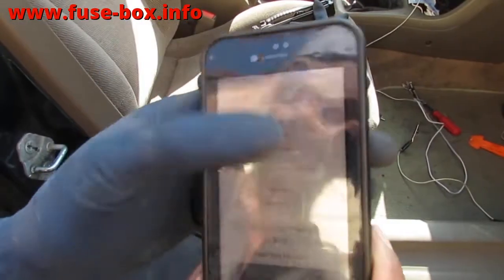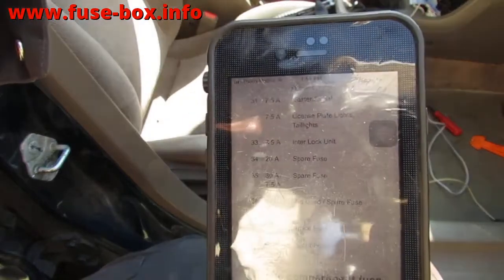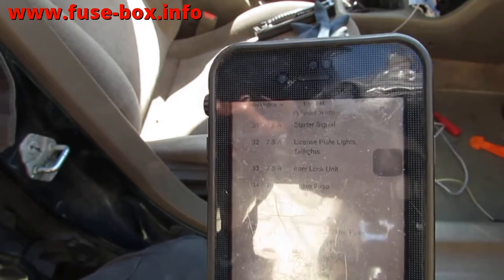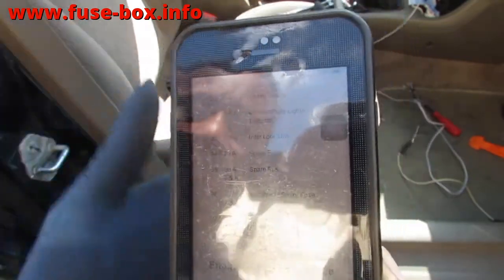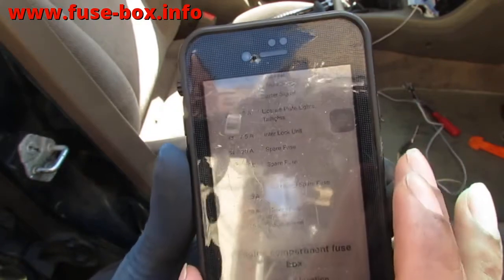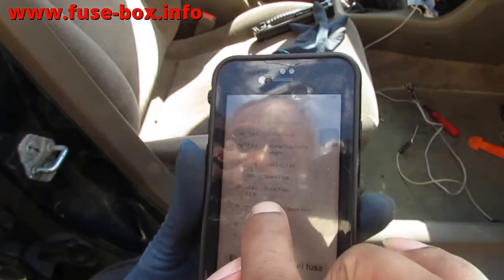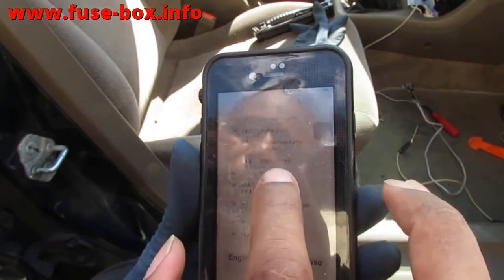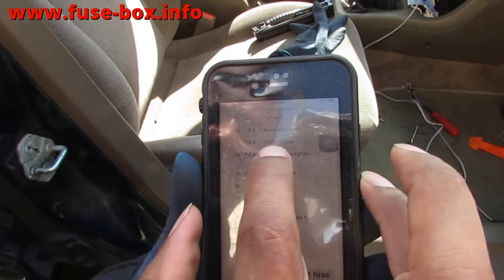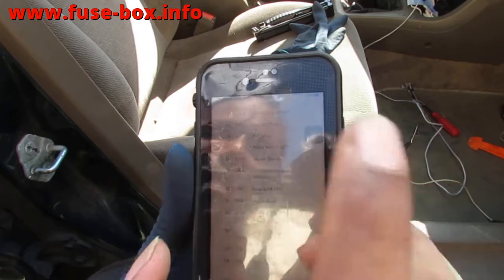Basically, there's this website called Fuse Box Info, and I'll put the link in the description of the video itself. You want to go there, because it gives you a hint of where the fuse boxes are located and what the fuses do. So, I already looked this over. On the interior, there is a fuse, position number 31, it's a 7.5 amp, and it's the starter signal right here. I'll show it to you on the screen.